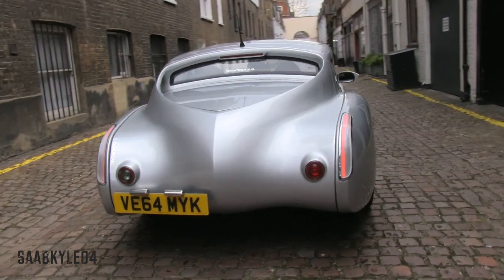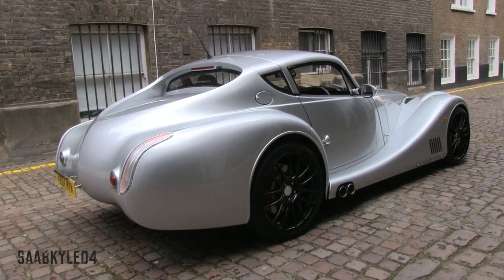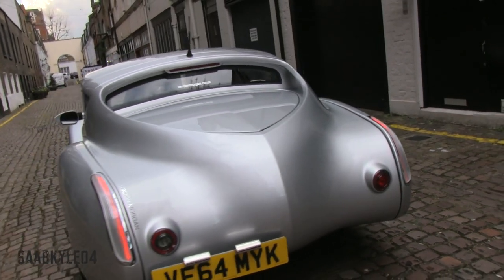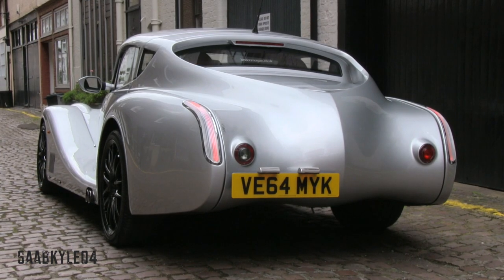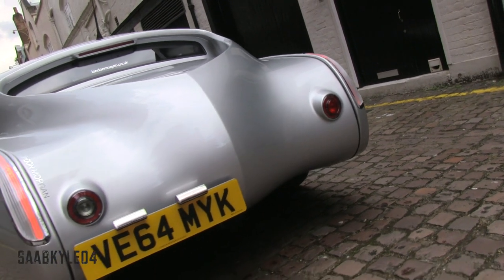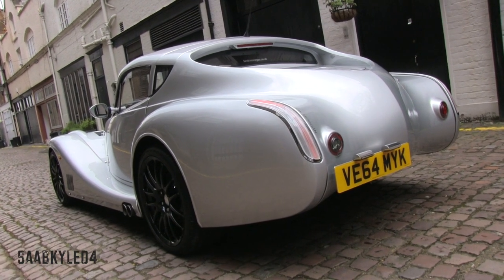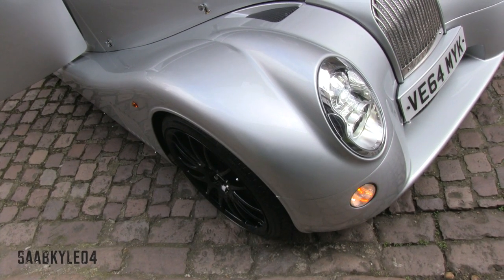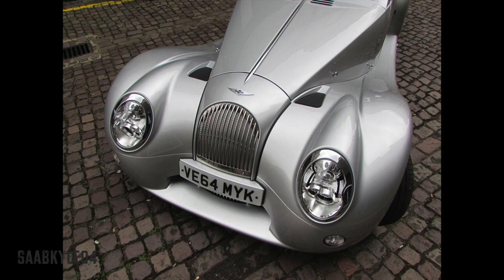In addition to its signature split-window boat-tail rear-end and bold rear quarters, the original Aero Max concept was the first Aero to sport a fresh styling language that would then be adopted by the Series 3. The Series 3 included restyled front wings, lights, and grille assembly, while continuing on with the updated 4.4-liter BMW V8 that debuted with the Series 2 as mentioned before. The original Series 1 and 2 cars used headlights from the new Volkswagen Beetle, which was understandably met with some controversy due to what many described as a cross-eyed look. Of course, that's subjective. The updated styling uses headlamps with integral washers and lower fascia fog lamps that were borrowed from Mini. The Supersports and Coupe, like the Aero Max, feature full vertical LED tail lamps within clear housings and the signature boat tail rear fascia treatment.